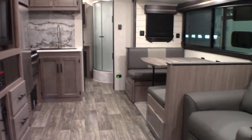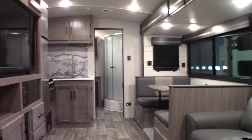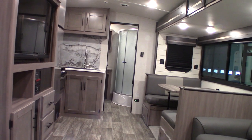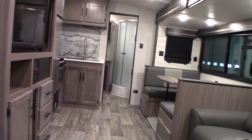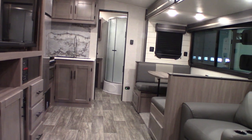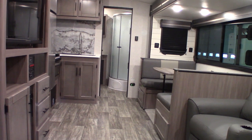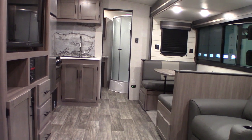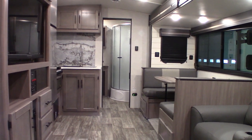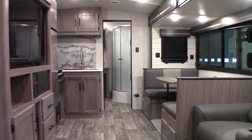Thank you for purchasing your trailer here at National RV Detroit. Please remember what I said about inspecting your roof every 60 days — that's important and it should be part of your regular maintenance schedule. Right now this trailer is winterized, so the water has been purged from the system and replaced with antifreeze, and the water heater is bypassed and empty. Once you start getting ready to camp, make sure you turn on the hot water with your city water hooked up and make sure your water heater tank fills up before you turn it on.